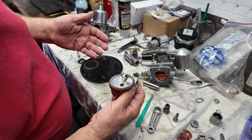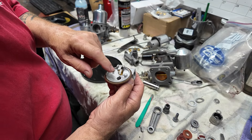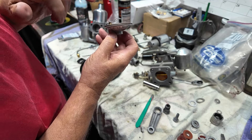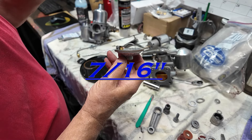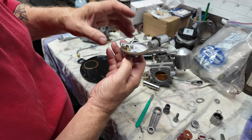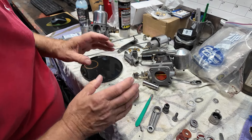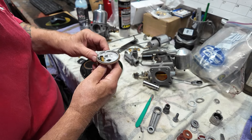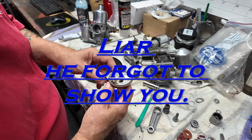Normally you wouldn't be getting fuel coming out of there, because if the fuel is up that high then this little baby here is not doing the right thing. And don't forget you do have to set the height of this — I've mentioned it in a previous video but I'll type it in now so that you know what the measurement should be. Just soak those in with a little bit of water — it really does make the job easier. It just slips straight on.